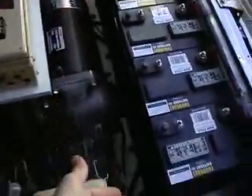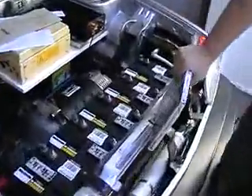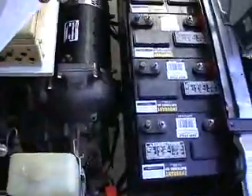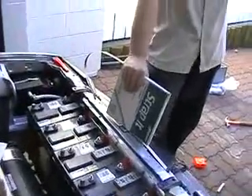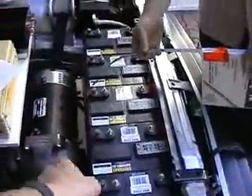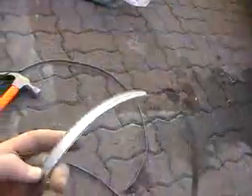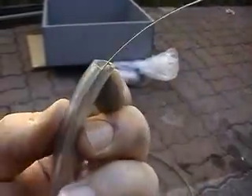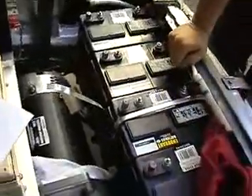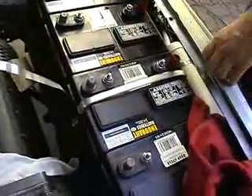While the special paint is drying for the rear box, we are now creating a surround for the batteries to stop them moving about. The batteries are now supported with their little supports around the sides and underneath. We are going to use some stainless steel strapping to secure each battery individually. To help insulate it, we have put each stainless steel strap through some clear PVC piping — it was a pain getting it through there but we got it in the end and it is looking quite snazzy.